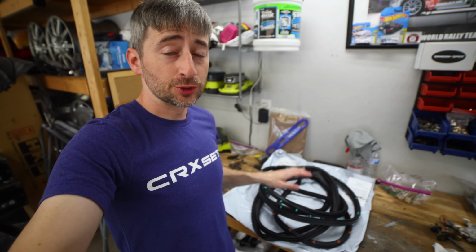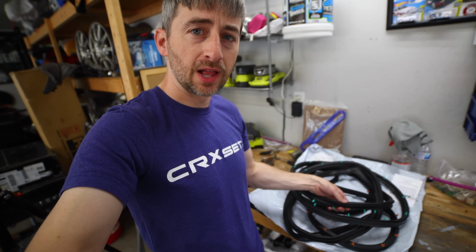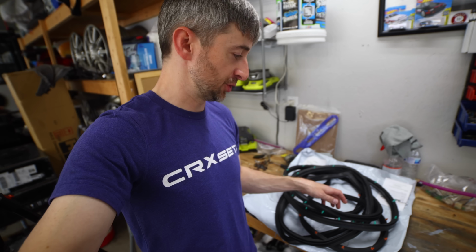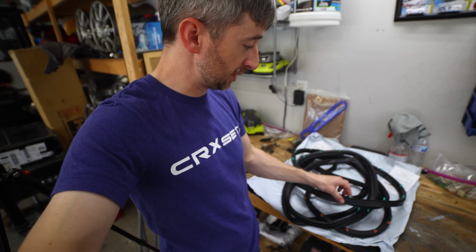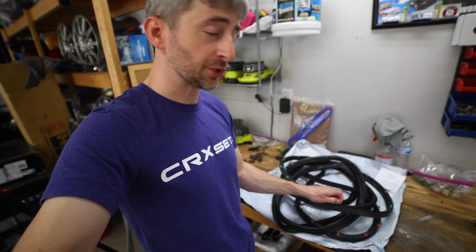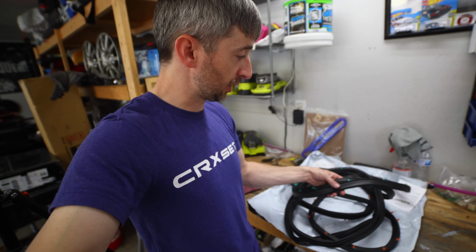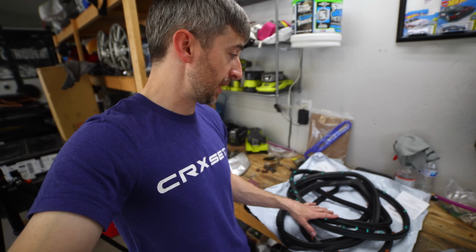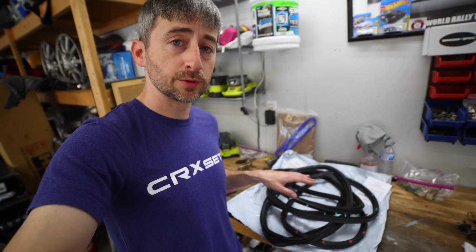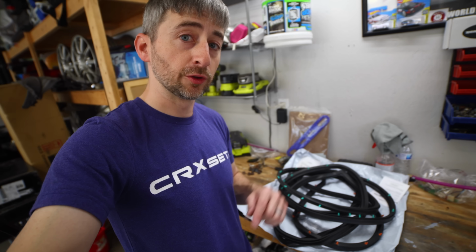Alright, as you can see, these things are super nice. They're brand new. The rubber looks amazing. They're very pliable and soft, just as they should be to allow the door to actually seal up. They do come with the clips in them, which is awesome because most of those clips will break when you pull off the old ones. So that's great. They are color coded. The green is one side and then the orange is the other side. They do come in pairs. So I will leave a link down in the description below for these, as well as the sub seals, which we'll install here in just a minute. I'm going to go ahead and put these main seals on, and then we'll move to those sub seals.